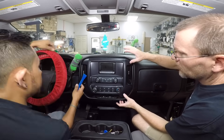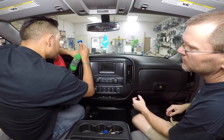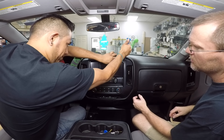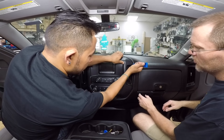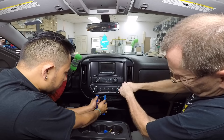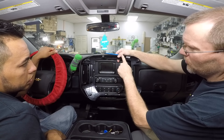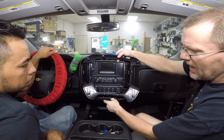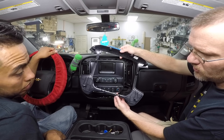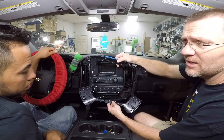When taking this radio out, the first thing you have to do is remove this exterior beauty panel. It's just a bunch of clips — and I mean a bunch — just like in typical GM fashion. They have way too many clips for what they're trying to do. As you can see, there are ten clips holding on this plastic, and they put them right where the fragile parts are, right at the bottom. Nice fragile parts, two big metal clips. So be real careful when you take this out.